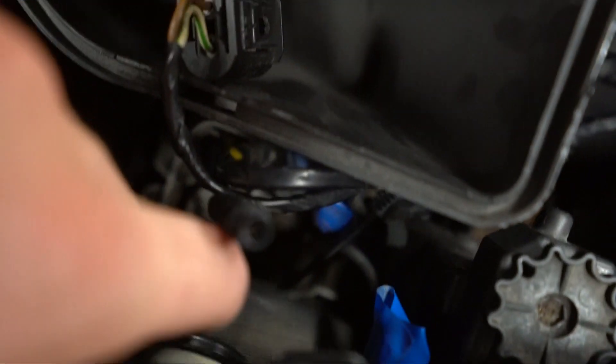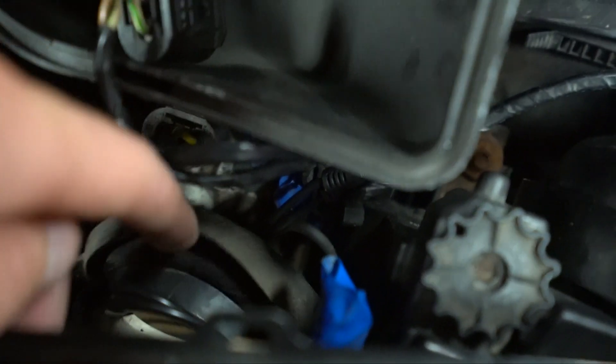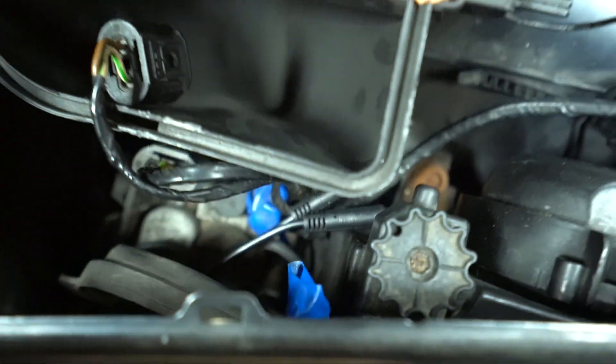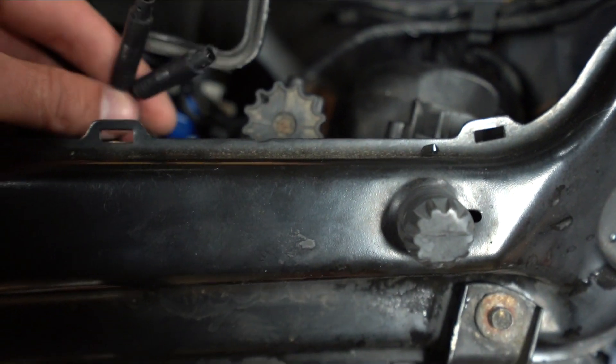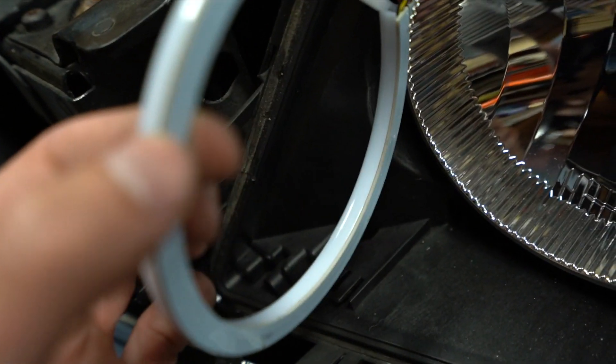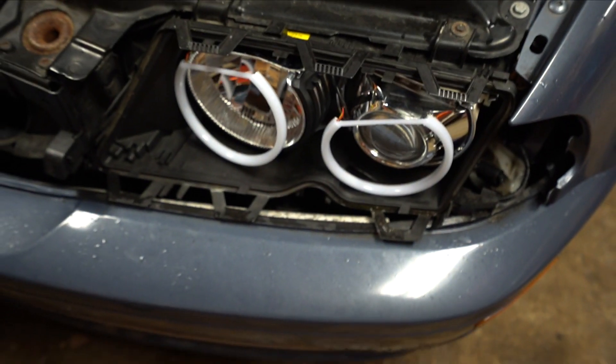You want to take off the rubber seal, take off the high beam light, pull it through that hole right there, and then put it on the inside of the seal where the bulb goes to allow for a nice tight fit. Now your cables are sitting out here. The next thing you want to do is line them up and put the double-sided tape that's supplied on the back, and put the two clips on top to secure it.